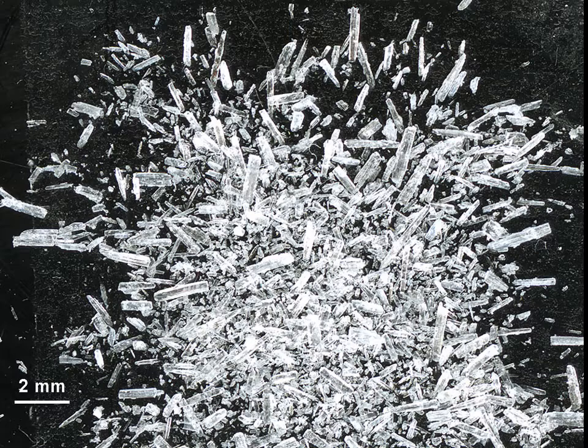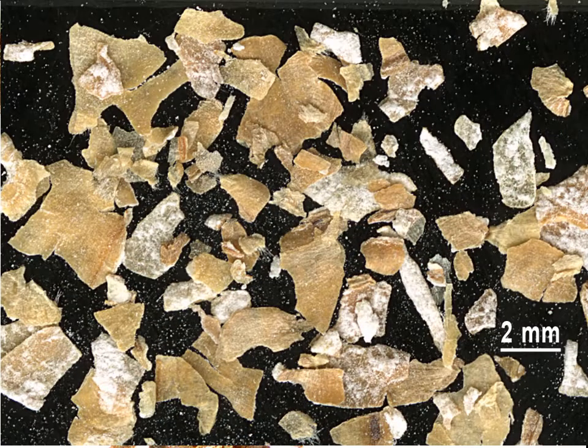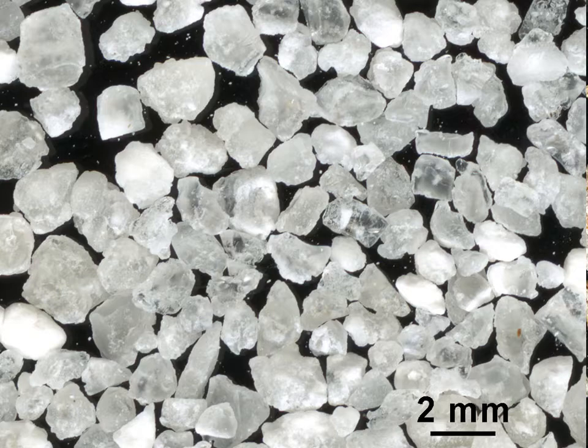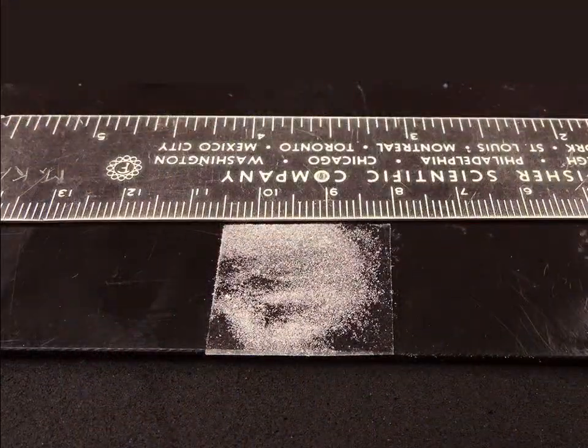The former images have been made possible because a flatbed scanner with maximum optical resolution of 9600 dpi, interpolated 12800 dpi, was used. The idea of taking images of small particles at a high resolution and expanding them over a larger area was thus easy to realize. There are many kinds of scanners available — for example, those stitching together large pieces of architectural drawings or reproducing accurately the colors of pieces of art. Only so-called very high resolution scanners operate at 4800 dpi, and very few work at 9600 dpi. None of the scanners reviewed is offering images of small objects.